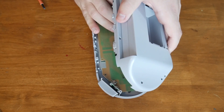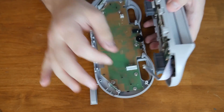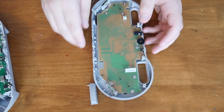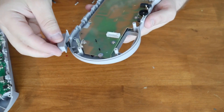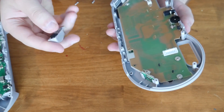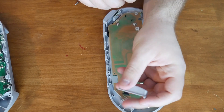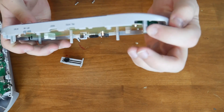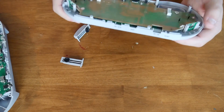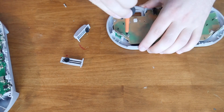So we got that all apart and there's stuff plugged in. Let me unplug these guys real quick. It does come unplugged. All right, so we have a lot of stuff happening here. So we know that the front kind of tries to mimic a Super Nintendo controller — at least it does its best with the button presses and everything. These are actually push plugs for the bumpers, or the shoulder buttons. They use a standard rubber plunger mechanism that just connects two points to register a press. They're very similar to what the 360 D-pad pads actually look like inside. And there are a couple more screws holding it in here. These are soldered — this is for the controller board. Let's take these out.